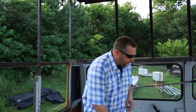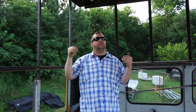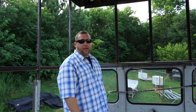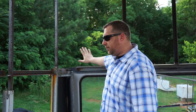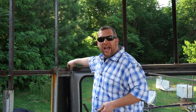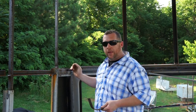On the back corner, what I'm going to be doing is using the metal that I took out of the ceiling of the inside of the bus — it's a little thicker than the normal metal that was on the sides. I'm going to take it and rivet it to the side of the bus, then fold and bend it around to create my skin and the outside of the bus to close all this in. The bus already has an angle here — a rounded angle where it's riveted — so I'm going to be taking those rivets out and using those holes to secure the bottom part of that metal across here.